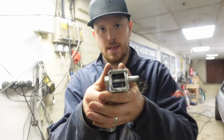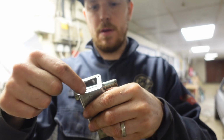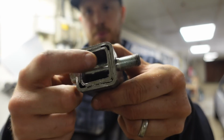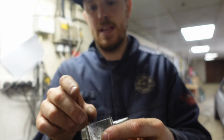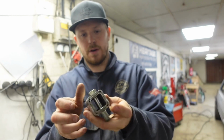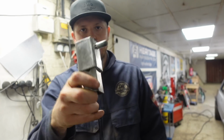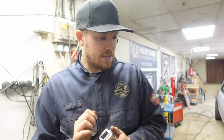Now what I've done, obviously, I've sent that all the way up, so we'll weld it all the way around there. We'll weld it around the top, and I've just put some bits of plate inside it to pack it out, because the internal sizing was 3mm, so I've got a bit of 1.5 either side and a bit of 1.5 either side. In the middle, bang on where it needs to be. That bolts in there so them holes all line up for when we weld it together.